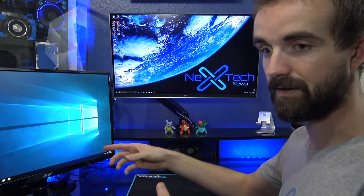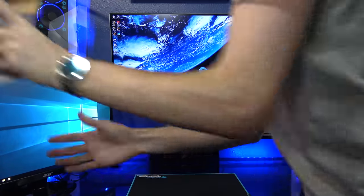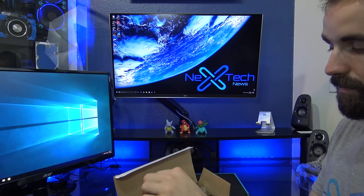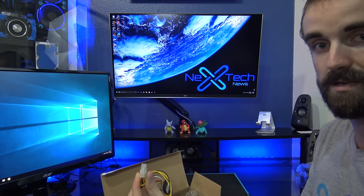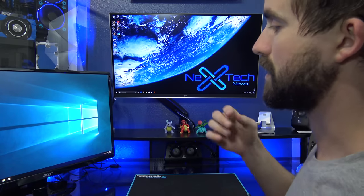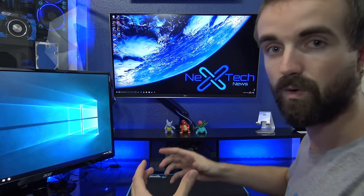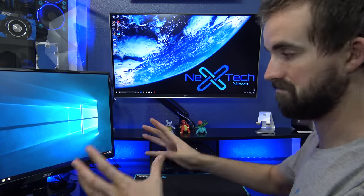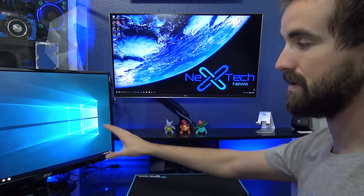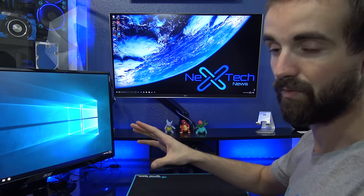What ended up happening in the build is you could see that I had a power supply. Let me grab it. So I had a Pico power supply here, but this one only comes with a 4-pin CPU connector. And obviously that's not gonna work when you have an 8-pin CPU power connector on the motherboard. And so I was able to use the one that comes with the actual case, which I didn't really realize it had that, but that worked out. But I'm not sure how many watts that one is. So I'm gonna try to run a CPU stress test on this once I've installed all the drivers I need, and we'll see if it can run everything.